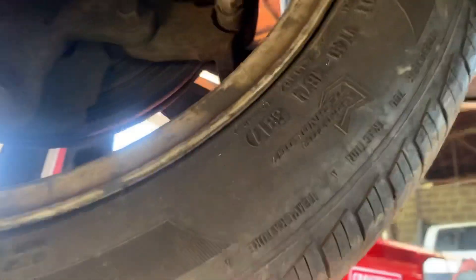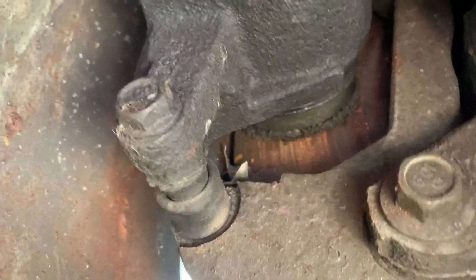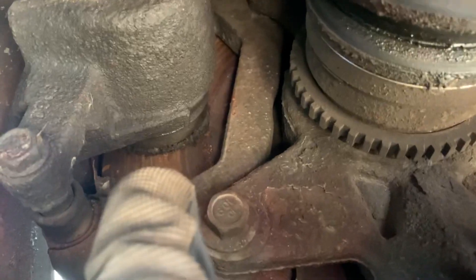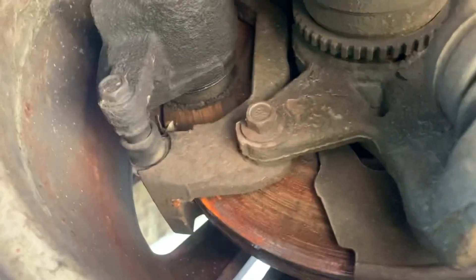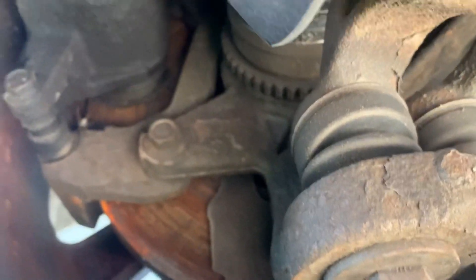As you can see, there is a brake caliper, brake pads, and brake rotor on one side. But come over to this side — what's missing? Look at that. There are no brake pads whatsoever. The piston is pushed all the way out and all the brake fluid has leaked out. So it has destroyed this brake rotor and probably that piston as well.